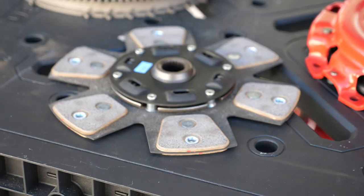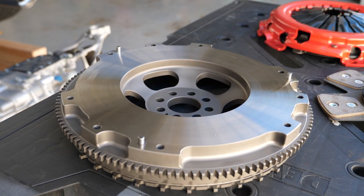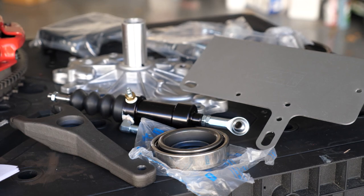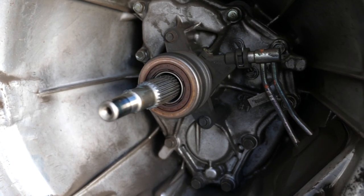What is going on YouTube and welcome to another video. In this one I'm going to be installing a six puck ceramic clutch along with the pressure plate and lightweight flywheel in the 370Z. I'm going to be making these upgrades to get me ready for forced induction in the coming months. I'm also going to be installing a slave cylinder elimination kit from Z1 Motorsports to take out the factory OEM slave cylinder, which is known to go bad after a while. So I'm going to take that out now before I end up on the side of the road without a clutch.